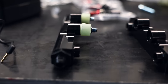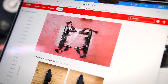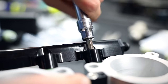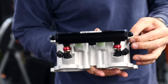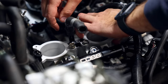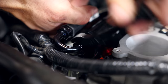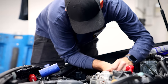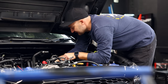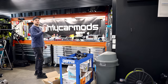To future-proof tuning this car, I'm using some big injectors, which means the car will no longer run without a retune. These are inserted into the intake runners, and then the new fuel rails are bolted down on top. I'm using about three different COB kits - you can mix and match depending on how far you want to go. My theory is if you've taken the time to rip your intake manifold off, it's probably worth upgrading it all at once. It also comes with fuel lines made from braided hose with AN fittings, which are E85 proof. Use a bit of lubricant on the threads as these can be a little tricky compared with rubber lines.